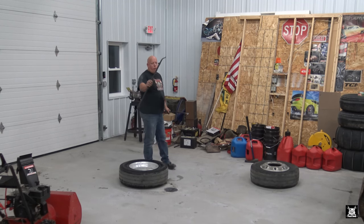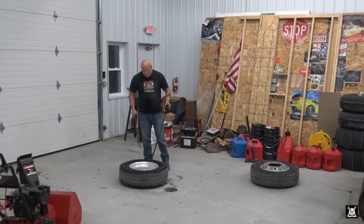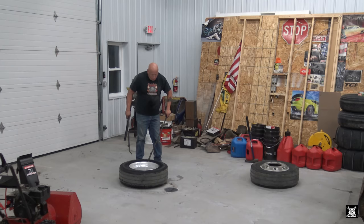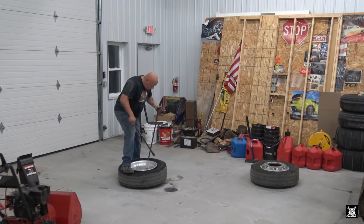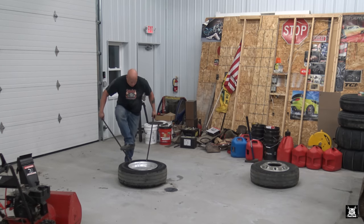So your basic tire spoon looks like that. You have two of them. Put it so the dish is up, hub face down. You gotta push this piece of tire in that indent. See, right here is the indent. You gotta push this side down and roll it over. Before you do, about a quarter, a little less than a full quarter, right about there.